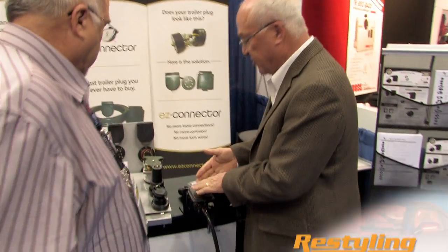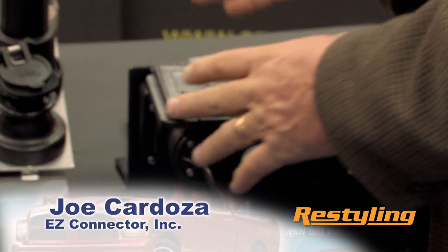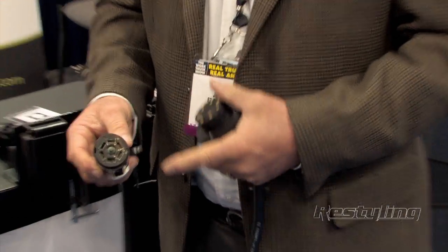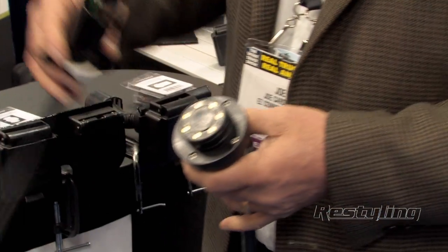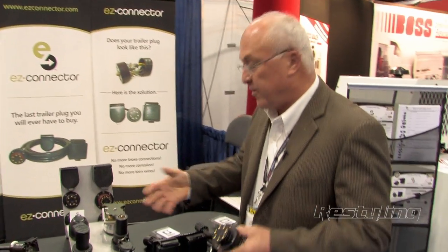This is essentially what we won Best New Product with at the SEMA show a couple of years ago. It is a sealed connector compared to what you typically see on a trailer. Oftentimes you'll see corrosion on the end, and what you don't see — especially in molded plugs — is the corrosion that occurs in the back, eventually causing wire failure. That corrosion, or oxidation, creates resistance, which causes problems with your brakes and lights. We've all seen trailers going down the road with lights blinking and not making good connection.